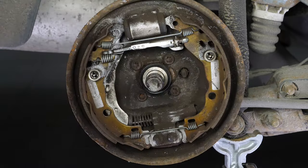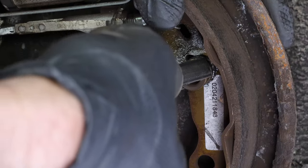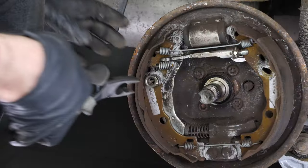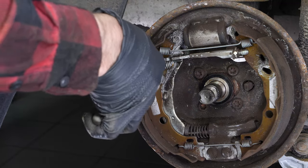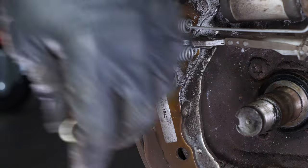You can now access the brake mechanism. Now you have to remove the mounting system of the shoes. Using pliers while holding the rod from behind, unclip the hold down parts that hold the shoes, pressing on the springs and turning a quarter turn to release them.